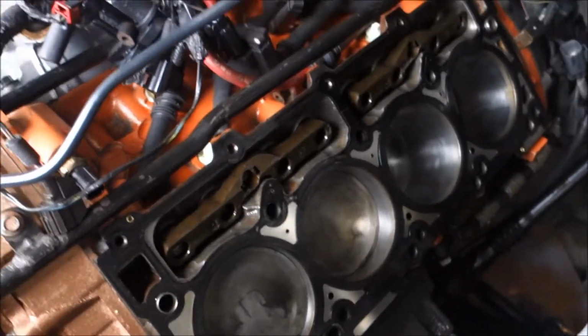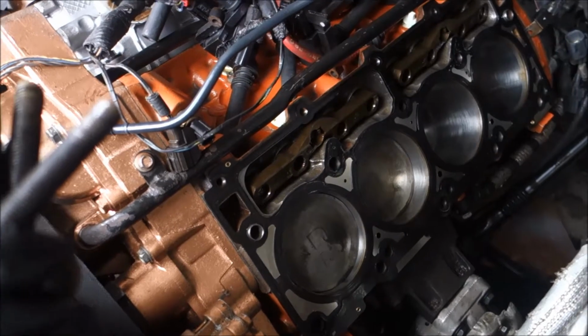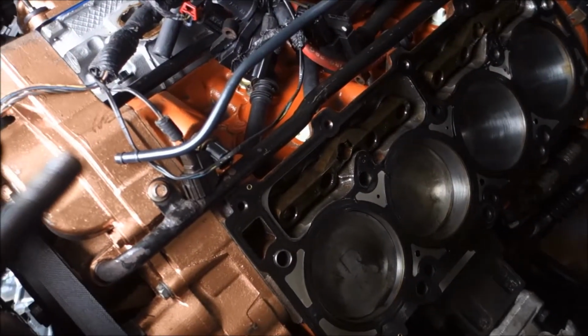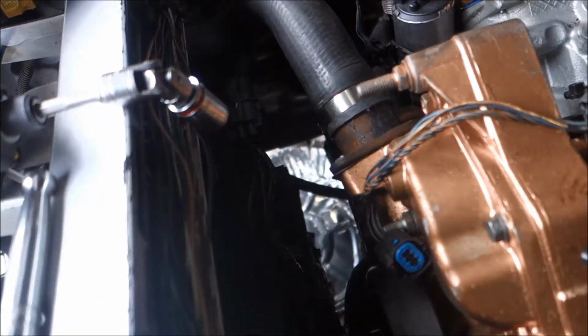The cylinders look fine though. There's nothing abnormal about them at all. I mean, it didn't even get to 180 degrees for the thermostat to open, so no coolant was even able to flow through the thermostat. I tried to open the radiator pan, and down there is completely dry.